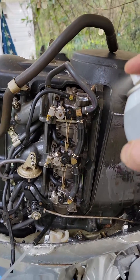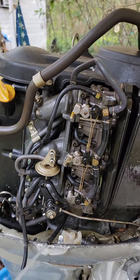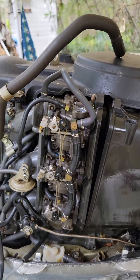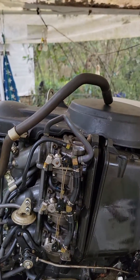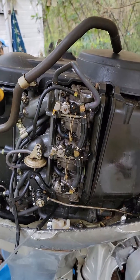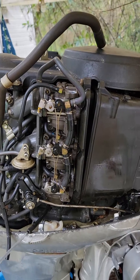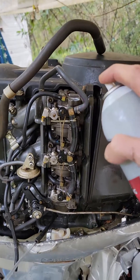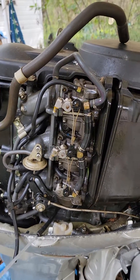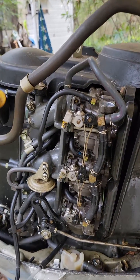See how it's running up? I definitely have a carburetor problem. There you go — that's an easy way to tell if you've got a carburetor problem or a problem with your spark. A little bit of carburetor cleaner — hear that? Definitely a carburetor problem.